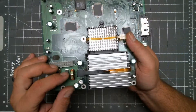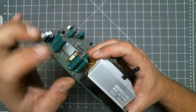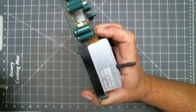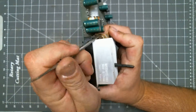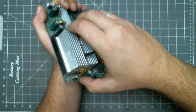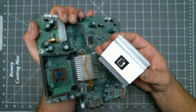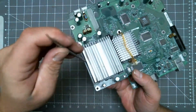Back to the main board — we are going to remove the heat sinks. We lift the black lever up. They have a hook and latch. We need to push down on this while prying the hook away from the latch, while lifting it up. Now that it's free, release the hook from the other side and lift it off. Then we can remove the heat sink. Sometimes they are stuck on really good — you may have to pry the heat sink away from the processor.